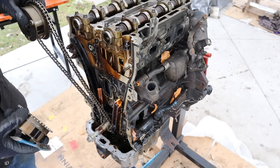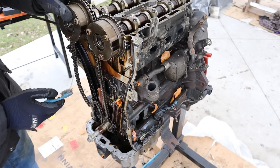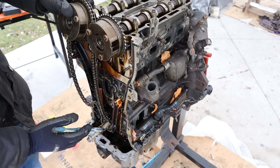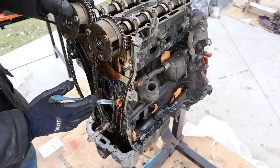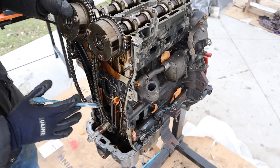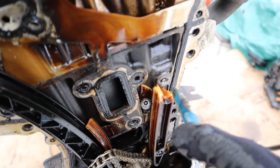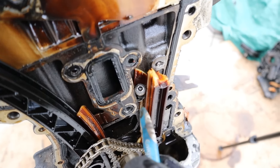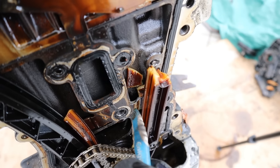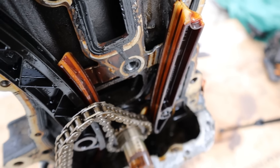Taking a look at the timing system on this Ecotec engine, it's pretty straightforward. You've got your dual cams up at the top, and the chain goes directly from cam to crankshaft with two timing slides. Now this timing slide here is completely failed, and this engine has a lot of carnage inside. You can see that this timing chain slide is completely snapped off, and there's bits of it back there. There's also this pin or bolt here that's just sitting over here — you can see just the carnage of this thing.